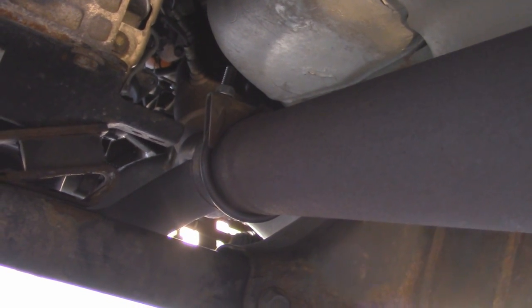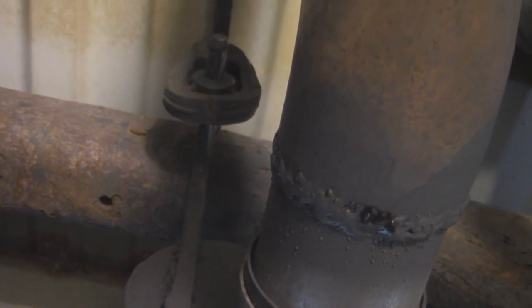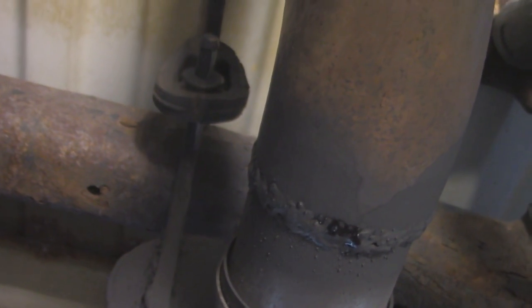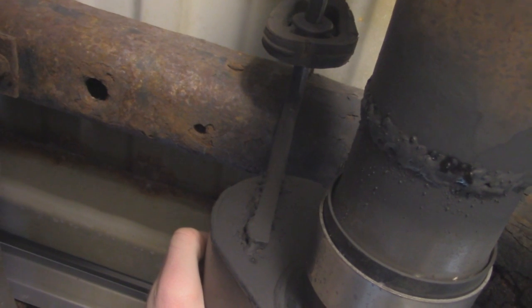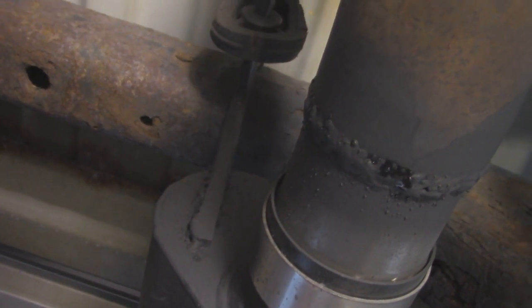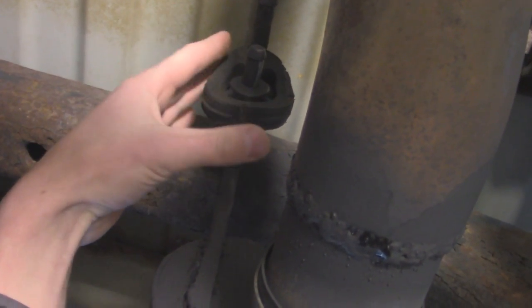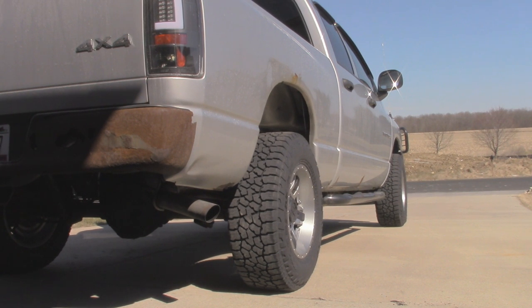It's a couple days later now. I put the front clamp on before driving, which eliminated the weird twisting motion. On the backside of the muffler, I welded on one of the old hangers from the old exhaust so it's nice and solid. I applied high-temperature paint over the welds on the pipes to prevent rusting. Now the whole exhaust is solid in there. When welding the hanger I jacked up the muffler about an inch so that when the weight sags back down, there's positive pressure on the isolator so it's actually doing its job. We're going to do a sound test outside the garage to avoid echo — it is a bit windy today so apologies for any audio issues.